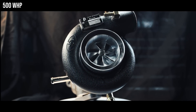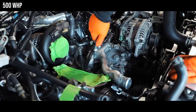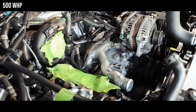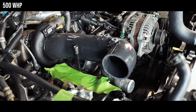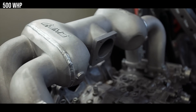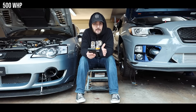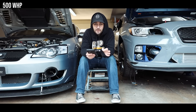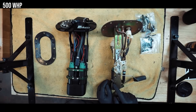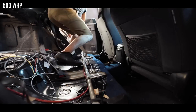Here are the changes specific to the 500 WHP range. You're going to be swapping to an FP Black turbo — it's a very good turbo, but there are fitment issues around the TGVs on Subarus. We dealt with this on the 05 STI build and while we got it to fit, it was a pain. The FP Black uses a 3.3-inch turbo inlet, up from the 2.4-inch on most turbos. With that larger inlet, I advise swapping to an AMS intake manifold, which gives you more clearance around the turbo. If you're not going to do the AMS manifold, get some 8mm phenolic spacers from IAG or Torque Solutions for clearancing. You're also going to want the radium dual fuel pump setup with two AEM 340 liter-per-hour pumps, plus an iWire hardwire kit for the fuel pump so it's running at 100% all the time.